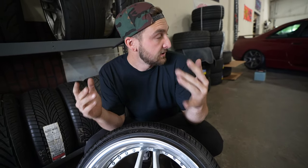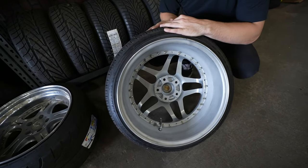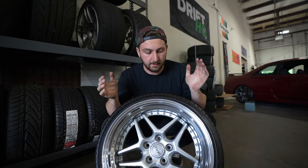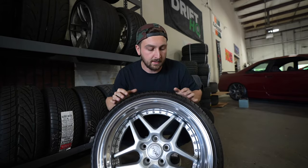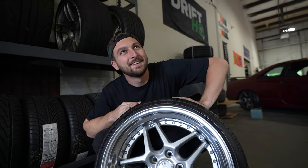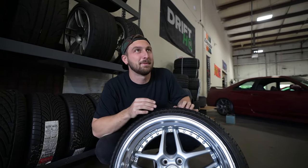The offset is around plus 32, which is fantastic, because chasers - unless you want to add extra camber - really don't like anything more than plus 22. Plus 22 is already aggressive. We got the lips, barrels, and hardware brand new from 3Piece.us. We love the quality - super nice, strong, thick lip on it. So if you ever curb these things, you can sand them down. Support your local polisher.